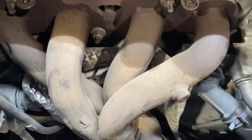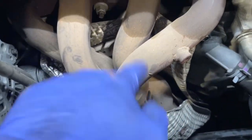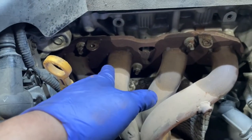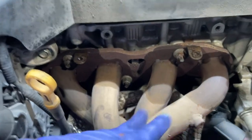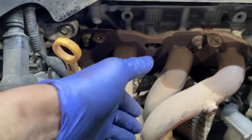We're back up top. I was able to get the O2 sensor out with another O2 sensor socket. Now we're just going to remove it from the engine itself - it's going to be five number 15 nuts all around. All we've got to do is remove those and pull it straight up, and that's pretty much it. We'll transfer all the heat shields over.